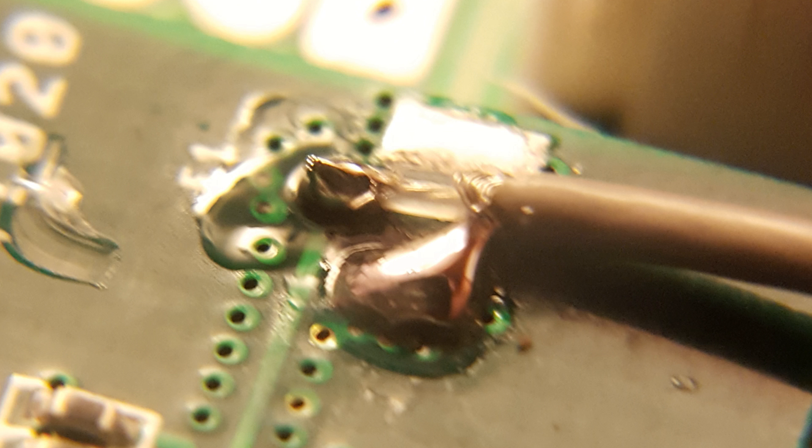I don't have video of the soldering because it is such fiddly work — there's no way I could record it. My camera won't zoom in tight enough. What I'm going to show you instead is a close-up loop of the finished joint. I feel okay about this, though I don't love that the antenna wire is sticking up out of the joint, or that there's a little crater near where the wire enters. I really want a nice smooth solder ball. On the other hand, the braided wire sheath and ground connection look pretty solid and smooth.